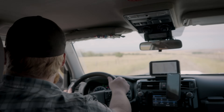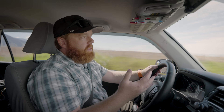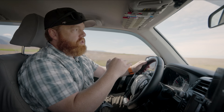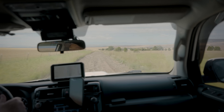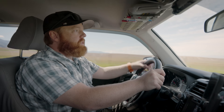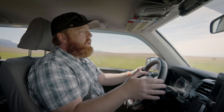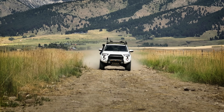What I really like about this system is that when you're inside driving, you don't have to get out if the terrain changes. With the app and the brain under the hood, I can be driving along and when it gets rockier or smoother I can adjust it manually in the app or just let it do its work automatically. If I hit a big pothole or a washed-out area, the brain detects that and changes the damping instantly. On multi-surface terrain it's really neat — it also adjusts side to side while cornering to firm up the outside shock and minimize body roll.